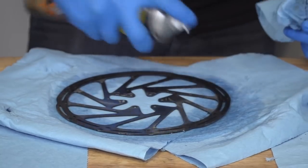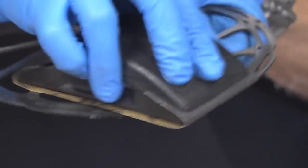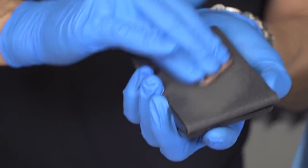Best use some isopropyl alcohol or disc brake cleaner. Clean the disc rotors down, then clean them with some hot water afterwards to make sure there's no residue. Use rubber or nitrile gloves to make sure you get no oil residue from your hands on the rotors. Then get some fine glass paper, sandpaper, or emery paper and just rough them up very slightly — just enough to add a tiny bit of texture so that when you start the bedding in process with the new pads, it can take a little faster. It just makes things easier and quicker. So the answer is no, but yes.